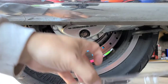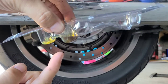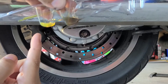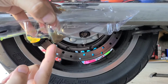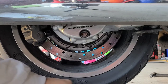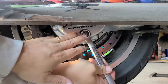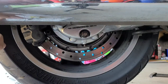This is what's been dripping out — not this, that's the new stuff. So that's the new oil and that's the old oil. If I rock that back and forth, it's still translucent. Here's your new Honda brand oil — it was replaced with Honda brand oil two years and just over 10,000 miles ago. I'm pretty happy with that. I put it in a jar as I drained it and we're supposed to get about 4.1 ounces back in. I'm going to snug the drain plug by hand, then bring the torque wrench back once we get the torque specs from the manual.